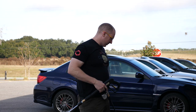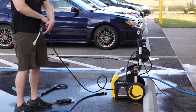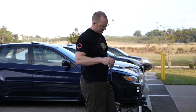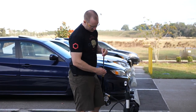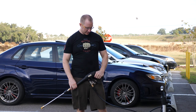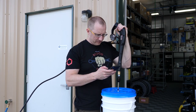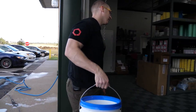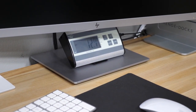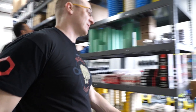The K2000 — $259 — has a hose reel, which is never a good thing, and it has a proprietary connection going to the hose reel. But at least this hose reel is useful. Running the water out beforehand doesn't really help, so this would be a hose extension only. Without some kind of crazy Karcher adapter, it's just not going to work to put an aftermarket hose on it. We're reading 1890 PSI. Flow: 12.7 amps, same 1.2 GPM — 1.19.